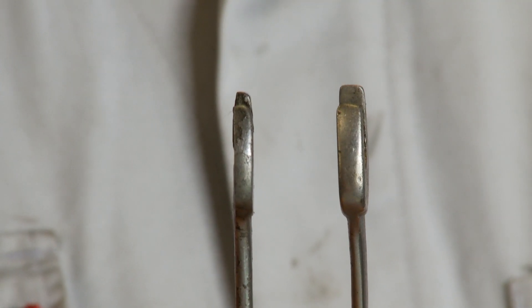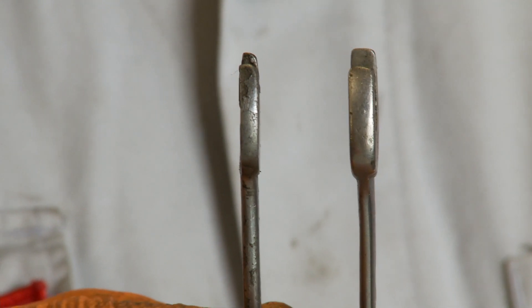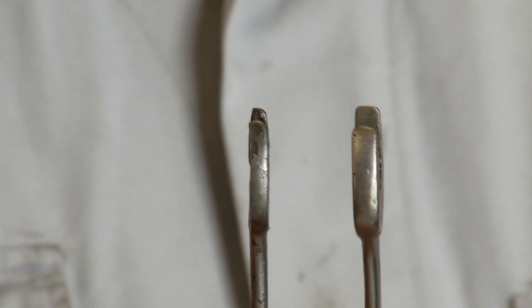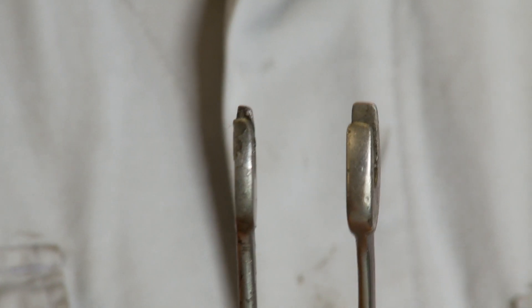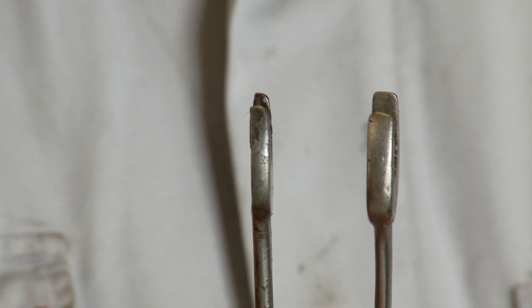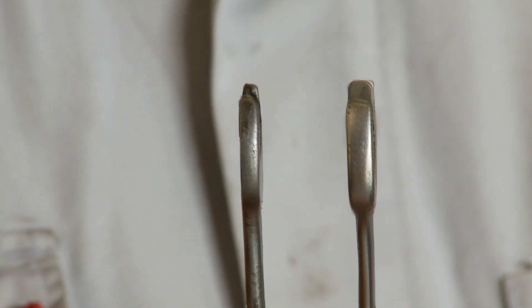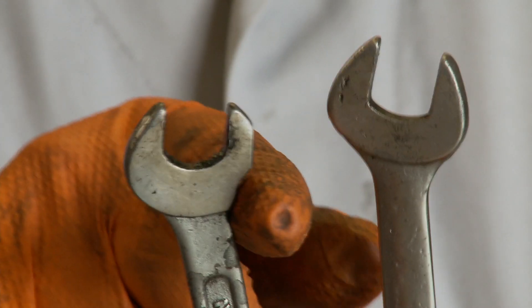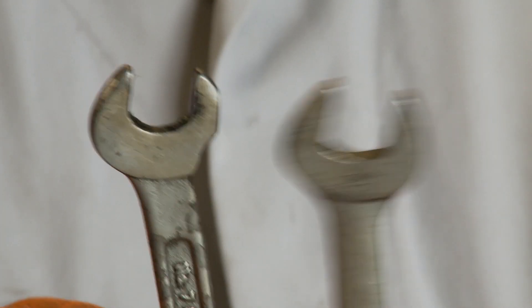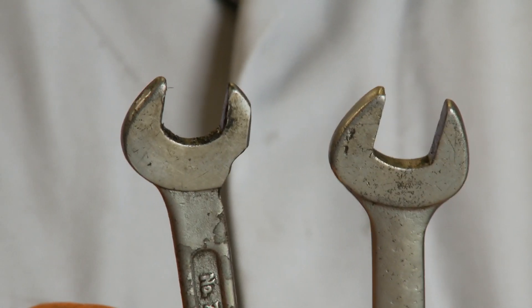The thickness of the modified spanner is a lot thinner than the normal one. This is necessary in order for you to be able to adjust the bolt that actually takes up the clearance between the pad and the disc on the caliper. You can also see that I've taken a notch out of the side here, which gives you a bit more play on the spanner so you can actually get it in and out as you adjust it.